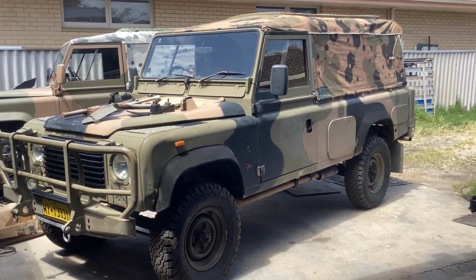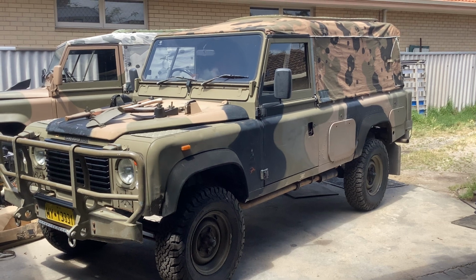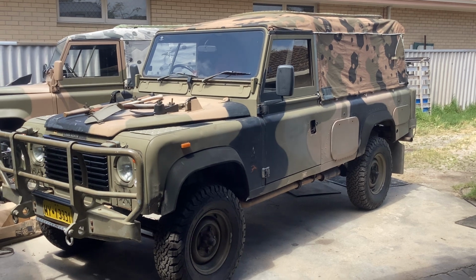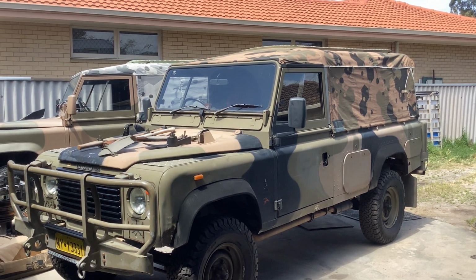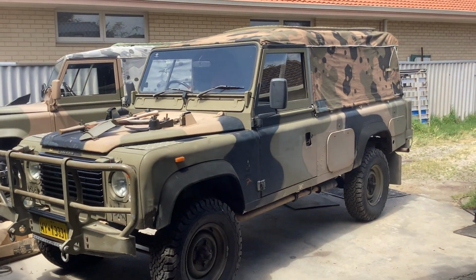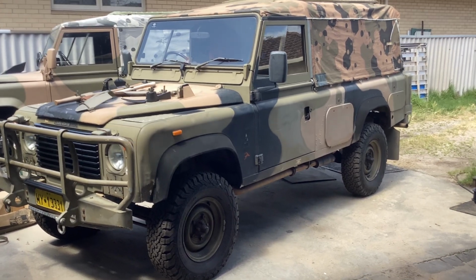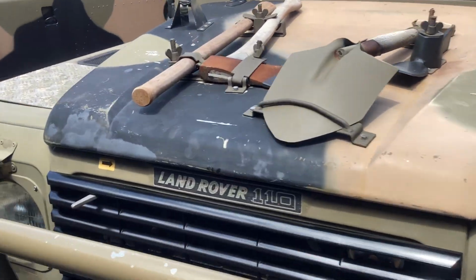Because for what I put on the kit and the install, if someone brings me a top-notch suspension kit and gets me to fit it, that's probably better for me because I'm going to charge more labour, because there's an awful lot more work involved. I'm just looking at my job board because I wrote down the hours. Three hours to fit it all. And that included cleaning the two towers up because they were rusty as hell, like they all are, unbolting all the rusty stuff. And this one I had to pry bar the old coils out because it started to go all rusty to the galvanised frame. Work that out.